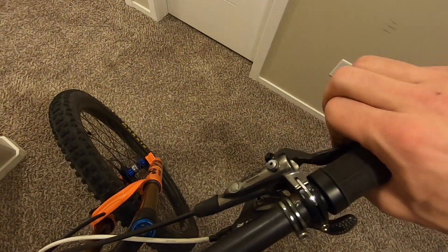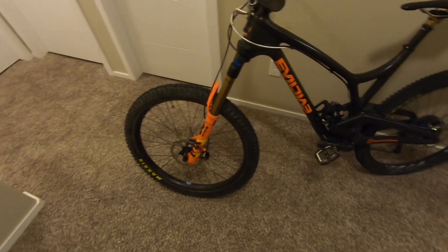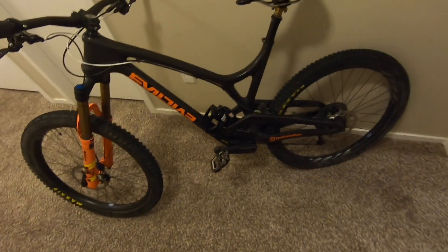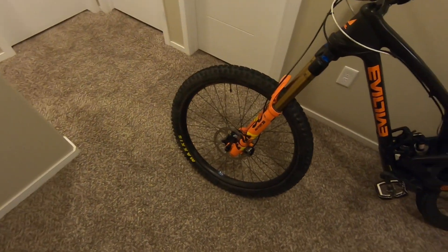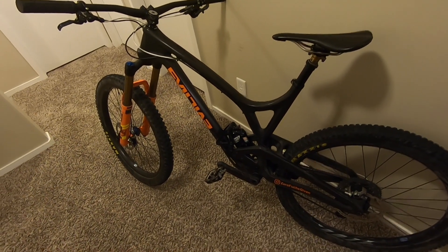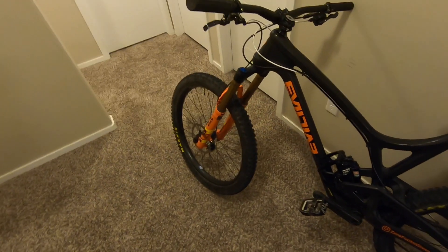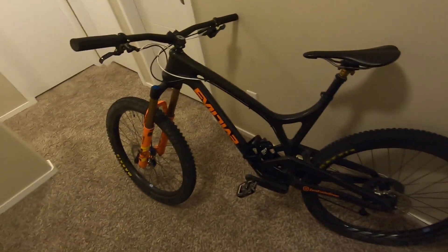If your brake levers end up with no brake feel, you're gonna have to bleed your brakes — that's my next episode on bleeding brakes. Now, depending on the pads you got: I got resin pads because they're a little quicker, but I don't like to wear my rotors since rotors are more expensive than brake pads. The metal ones won't wear as fast but will wear through your rotors faster, so I prefer resin. You'll want to bed in resin brakes — take your bike up to speed, slam on the brakes, not quite locking them up, but really get them in before you go ripping down some hills. Thanks, this has been Bike Repair in the Living Room — see you next time.